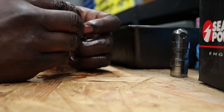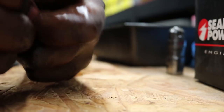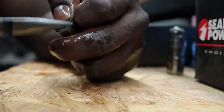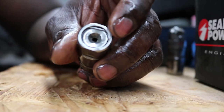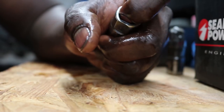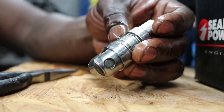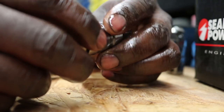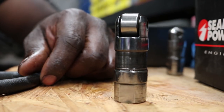Take the retaining clip and press it down — put the round side of the retainer in first. Once you get to that point, just squeeze the retainer. You may want to use needle-nose pliers if you're not very dexterous. The retainer goes into a groove at the top, then check it — make sure it's actuating up and down. Once it's pumped over with oil it's going to get really stiff. There you have it — a rebuilt lifter, cryo heat treated, micro polished, and the surface is now very hard and very slick. Rebuilt lifter, Junkyard Dog style.